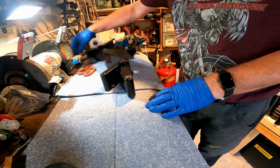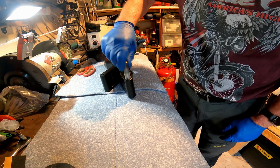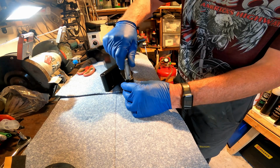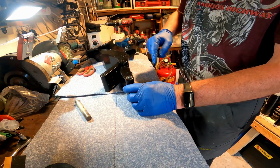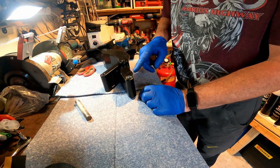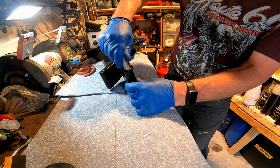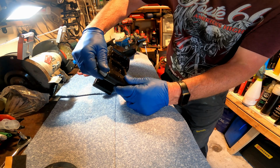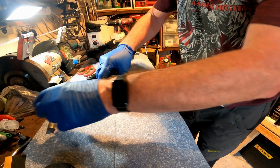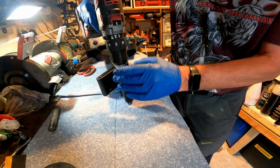So the plan is to try and maybe sand out that a wee bit, just to take any roughness out of it. I've already sanded the pins with it pivoting on. We'll give that a wee sand in here and at the other side. Then we will lubricate them with grease and see if we can get them in. And again, that's got to go in a particular way to ensure that the small grub screw catches that. So I'll maybe have to mark them. Okay, so let's just give a wee sand with the paper in there.